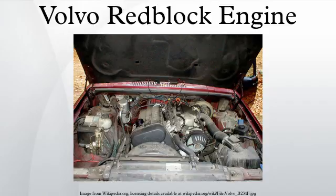The block differed from the standard B230 in that the auxiliary shaft was replaced with an external oil pump. The 16-valve head was itself a completely new design for Volvo, featuring a multi-piece design with a separate cam carrier and lower section. The later white block motors can trace their head design back to the two-piece setup found in the B204 and B234.